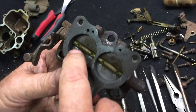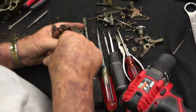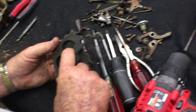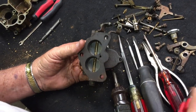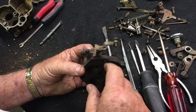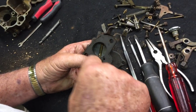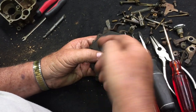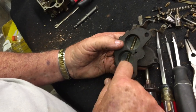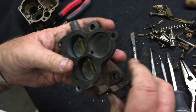Sometimes on these base screws, if they were peened over, what you can do is take a small drill and just dimple it slightly — that will cut the flange off the top and the screw will come out easier. If you break off a screw, it's not imperative if you're going to put an extended shaft in it. But if you're going back with a stock rebuild, you can take a #36 drill, drill straight through the screw from the back side, and the screw will pop out. Then run a 6-32 tap through the holes to freshen them up, and your plates will go right back in.